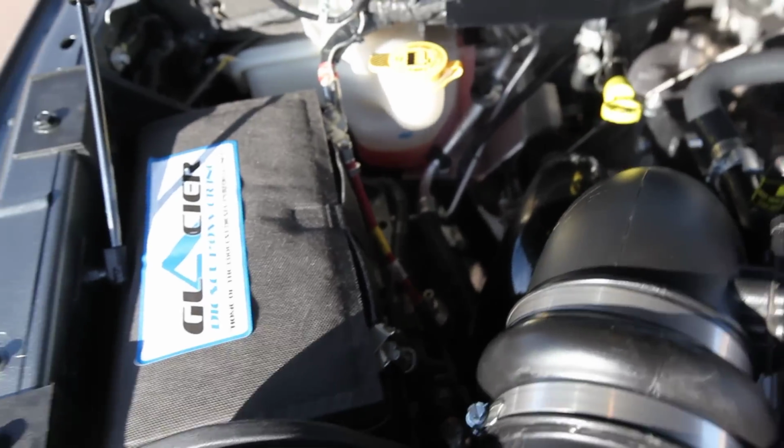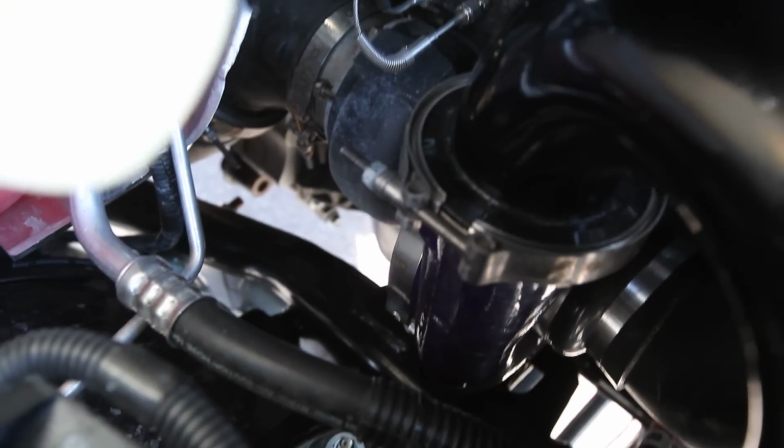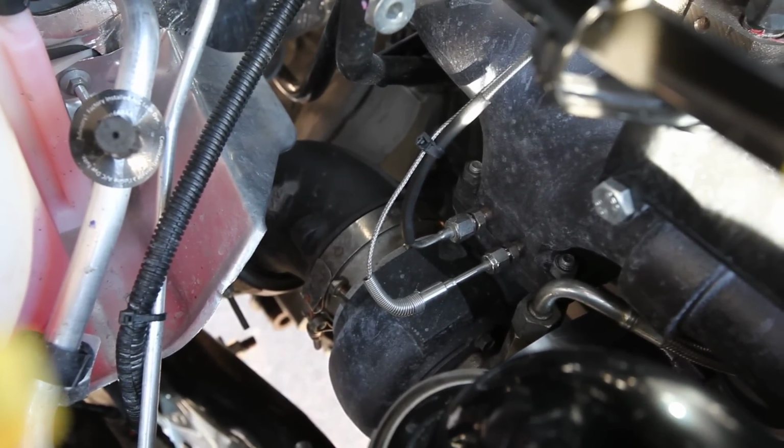Alright, down in here you got a ATS Aurora 5000. It's a 7183 turbo. Kind of hard to see because it's purple and everything in here is black. There you go. And you can see the two pyros, one for the H&S tuner and one for the Snow Performance water methanol injection kit.